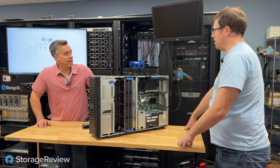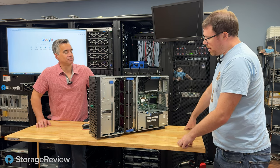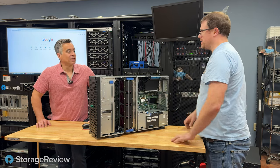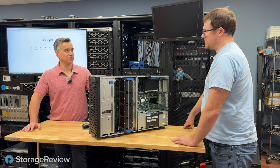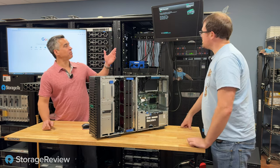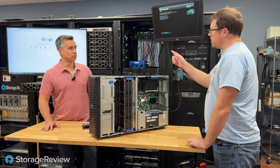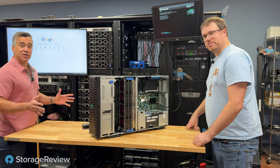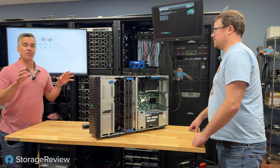This should eventually output to VGA as it boots. It probably knows the side door is off — these are designed to be serviced while on, so we're assuming that's okay. There's a really nice airflow coming off these massive heat sinks. Kevin wanted to put the door on but we left it off — it's more visually appealing that way. We've got the ILO IP address now, which means we can hit it from any device on the network to manage and update it. We'll pull up the interface using the administrator credentials from the sticker, and we'll also record the ILO 6 session to show you what it looks like on the ML350 Gen 11.